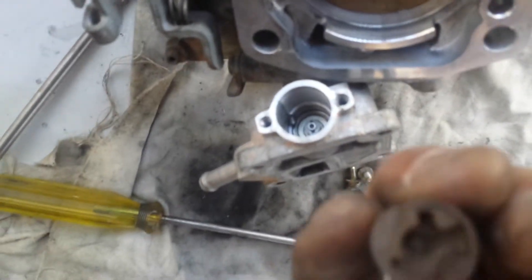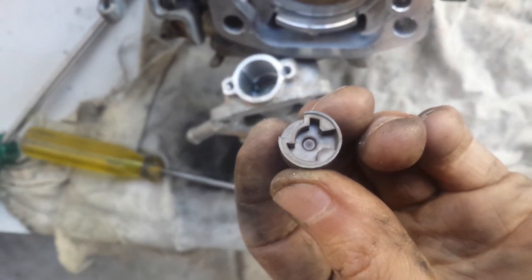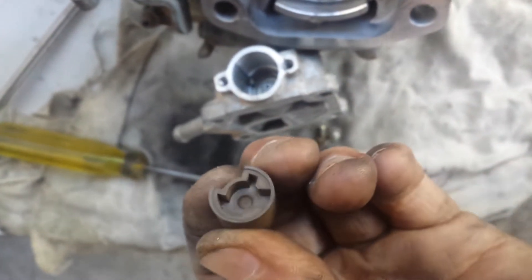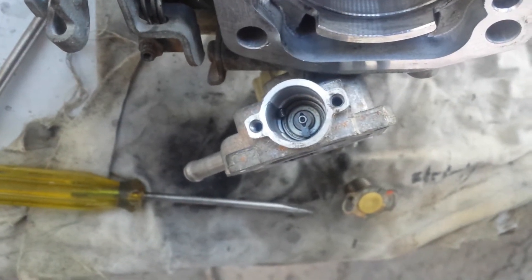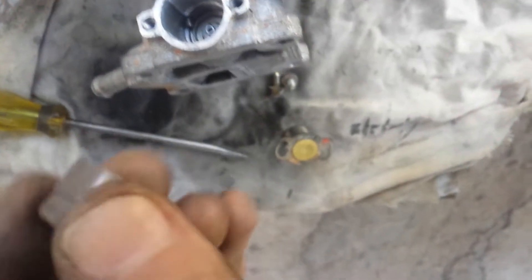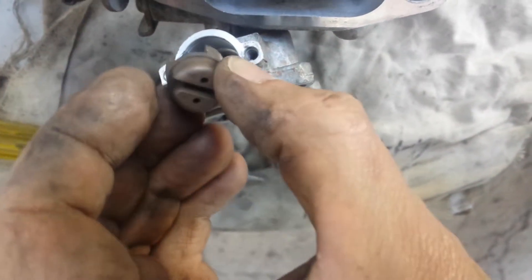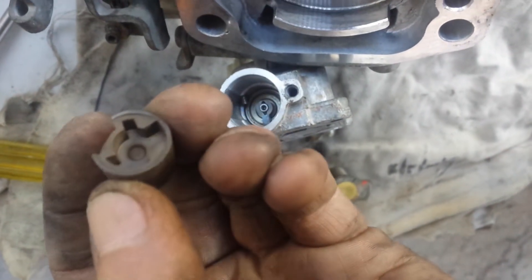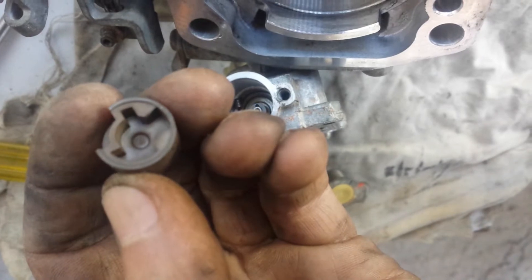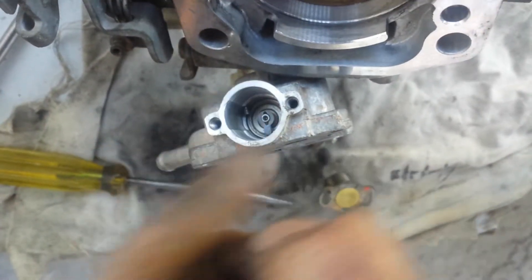There are a number of different cams here. What these cut-out recesses do is they run off a lug at the back there, so position is important. The set screw has to go into the gap, and that lug has to run in the other gaps. So take note of everything in there.